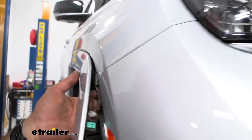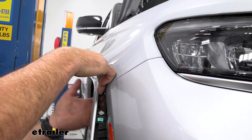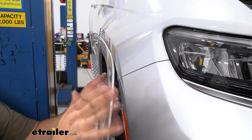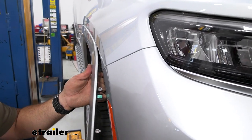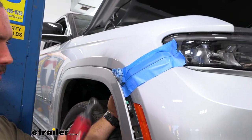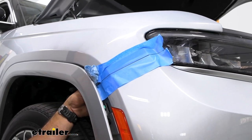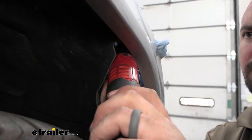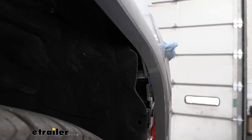To make this a little bit easier and keep this away from the body, first put a paper towel here — something that's not going to scratch the paint — to kind of keep this out. Also put a little bit of painter's tape along the seams to make sure we don't scratch as we take off or put our fascia back on. Sometimes paint against paint or against these clips can cause it to rub, so I'll get that set up and go ahead and repeat the same process on the other side.